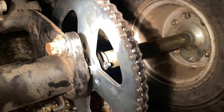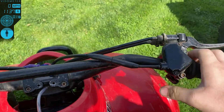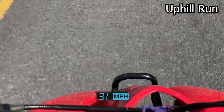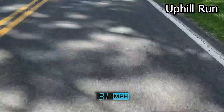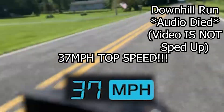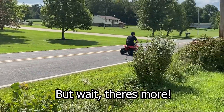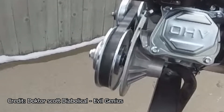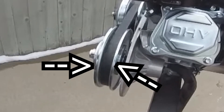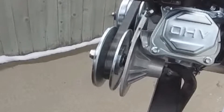Chain is on, nice and tight with the master link in there. I found this cool GPS speedometer app — let's see how fast we can go. This is going to be sketchy as hell. 41 miles per hour on a kid's four-wheeler! Holy crap, that is so fast. We found out the four-wheeler can actually go faster than 37 miles per hour, but the belt we have is too thick and doesn't allow the two plates on the torque converter to spread out enough to reach maximum speed ratio. Don't forget to subscribe so you don't miss our second speed run with the other belt.